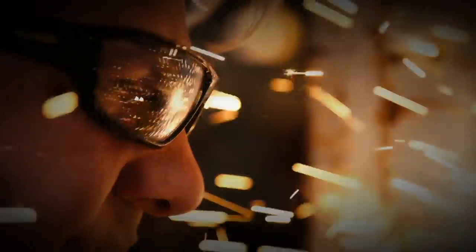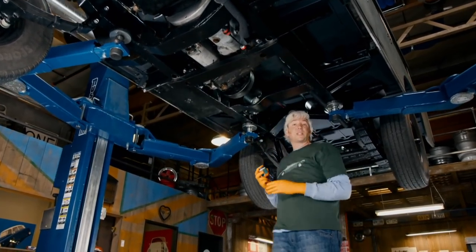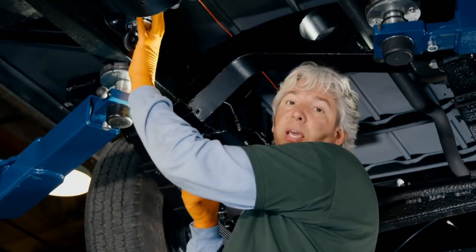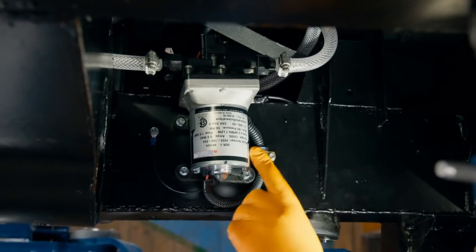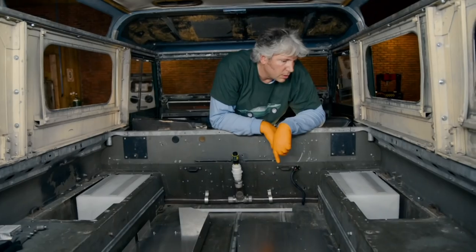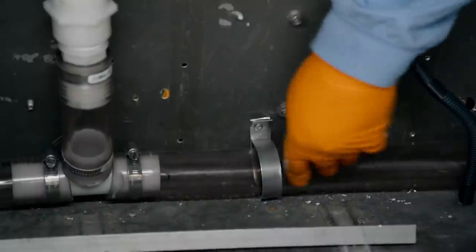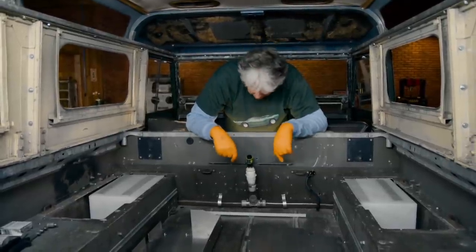It's going well. Now, having sorted out exactly where I want to keep our water tanks, I've now protected them from the environment by boxing them in on both sides, which is great. I've also bolted a water pump very securely to the chassis — nice and protected and out of the way. The idea is, of course, that it's going to push the water from the tanks all the way to the tap, which will be hidden in the cab, so we can pump dirty water in and clean water out. From this side, you can really see that the inner wings are protecting the tanks from the outside world. They're now in position and connected up, and I've used slightly bigger bore tubing for a bit more capacity, which also helps with the flow as you're trying to fill them up.